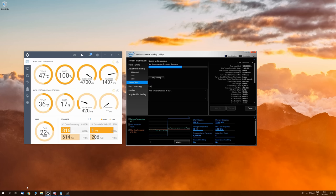I also have connected the Arctic P140 Bionics coolers to the system, and it's producing rather reasonable temperatures on the i9-9900K. If I do a very quick benchmark in Counter-Strike Global Offensive, then I can see I gained around 70 FPS going from my old i7-7700K at 5 GHz to this i9-9900K beast. But of course, I'm still going to overclock the i9-9900K in my system. I'm trying to aim for a 5 GHz overclock on all 8 cores, and considering that I'm currently sitting around 45 to 50 degrees Celsius at 100% load, I think that this should be a feasible target.